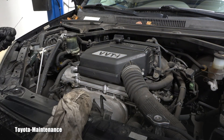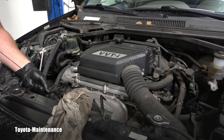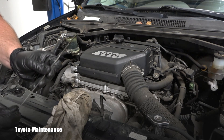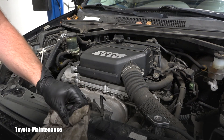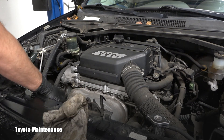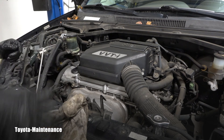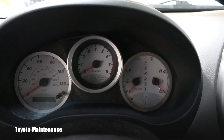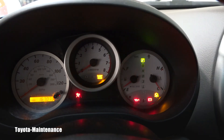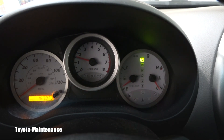With 3.5 quarts inside on a dry dipstick, the oil is touching exactly the F for full on both sides — perfect. I put the dipstick back, close the filler cap, start the engine, and let it run for about one minute. During this first start-up, watch the oil light — it needs to disappear quickly. One to two seconds max — perfect.